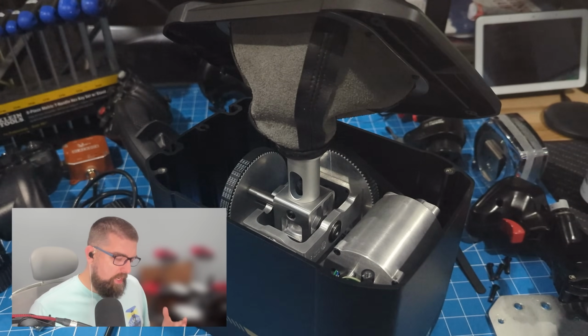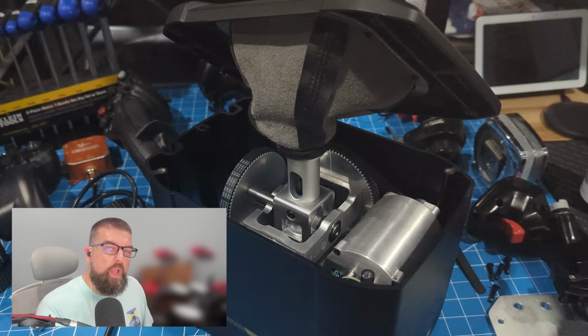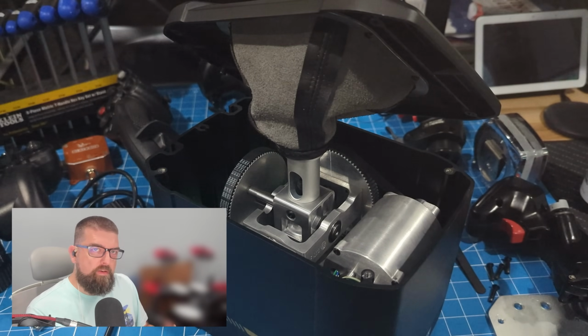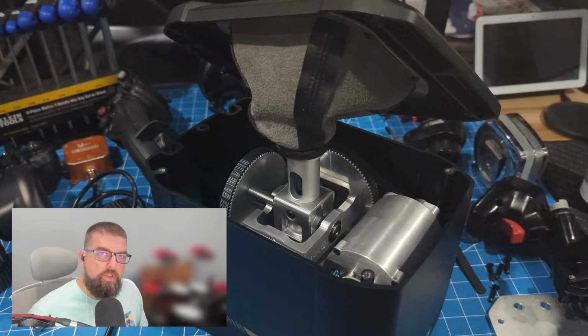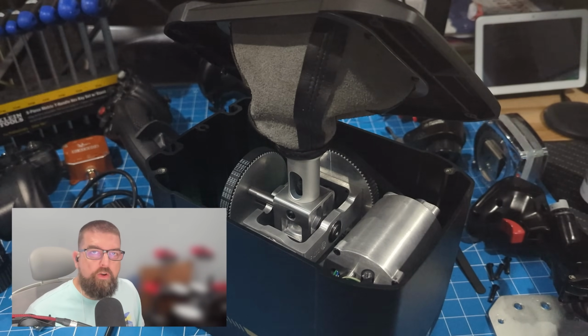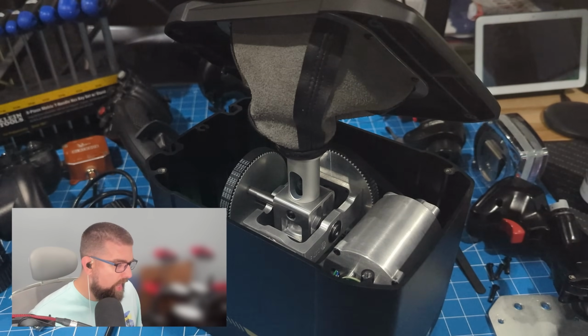And one of the things that everybody keeps saying is, how does this device cool itself from overuse? Because what happens is, when the motors start to get too hot, they will then have less force applied so they can cool down. So they're supposed to not overheat, and to do that, they kind of throttle themselves back, so to speak. And then ultimately, if it gets too hot, it will just turn off and not work at all. And so you can literally lose force feedback in an axis or both axes combined, depending on what you're doing and for how long. So my thought was, I'll try to mess with it and see how hot it gets.